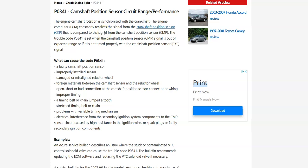What does this mean? The camshaft position sensor is used to detect the location of the camshaft as it spins and reports this back to the onboard computer for timing. The onboard computer is seeing an error inside this circuit. The usual causes are either a bad camshaft position sensor or a problem inside the wiring.